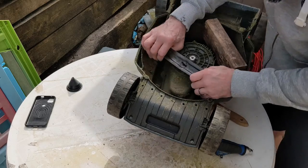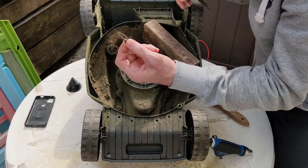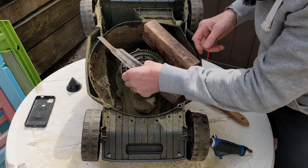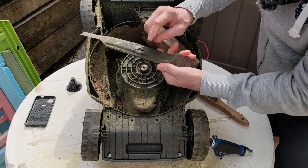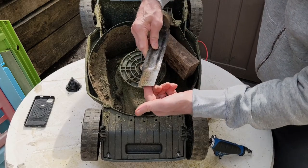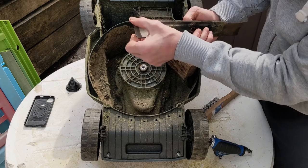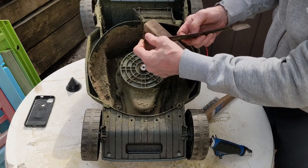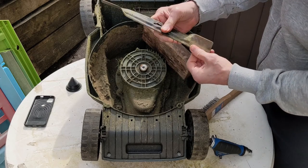Keep that bolt handy. I've got to make sure I put this back on the right way up. I think there's only one way you can put it — it's got some markings there, and the right side goes on top. I'm going to clean that end off as well. You can see that's where it cuts here and here — it spins that way and this thing catches the grass and flings it into the grass catch. Now as you can see, it's not very sharp at all. You don't want it too sharp, otherwise you'll get a lot of dings in it — or so I've read. But that's literally blunt as anything. Quite a bit of a ding out of that, so it could do with a bit of a sharpen.